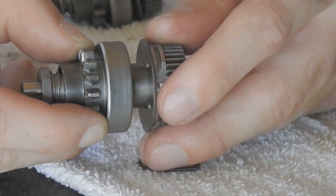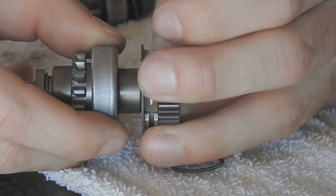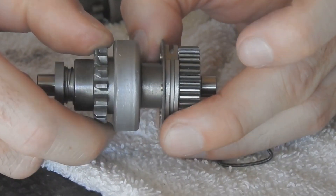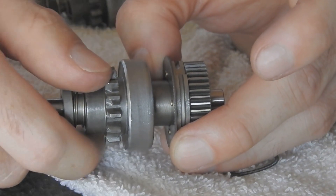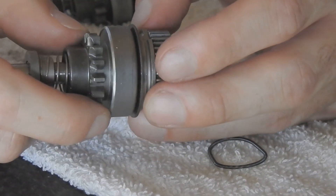The loss of load allows it to come back and disengage from the engine. It gets forced out, forcing the engine to spin, which holds it out. Once the engine starts, it's allowed to freely spin — there's no load on it because the one-way bearing allows it to spin in that direction, and it's allowed to come back and seat.